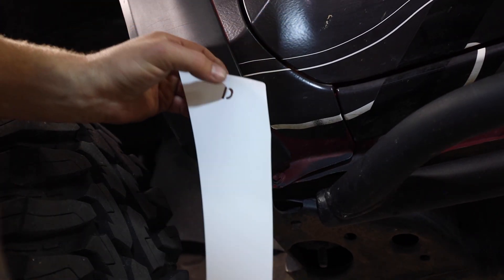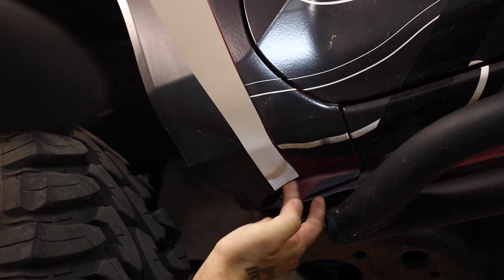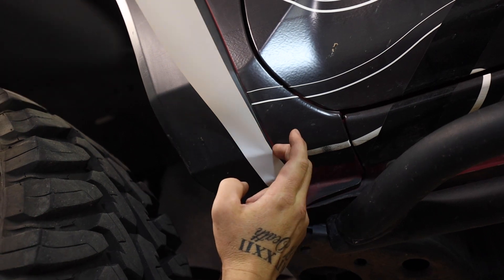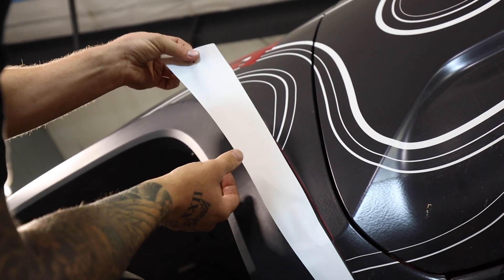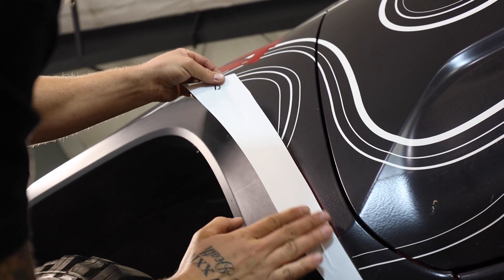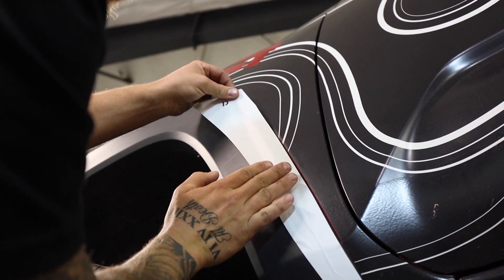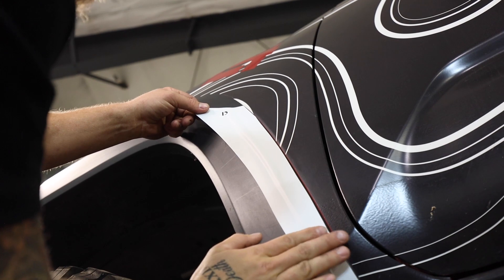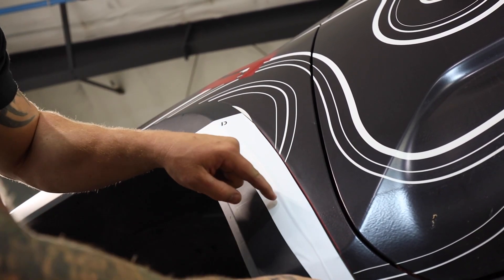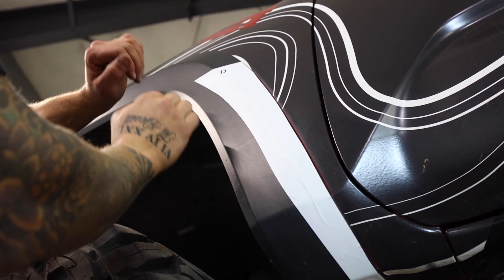Start with the letter D at the top of the vinyl going up towards the top of your fender. The small skinny end lines up right to the very back edge of the flare, and that's where you start to apply. Line up the back edge along the fender and follow your way around up the flare, keeping this template lined up with the edge of the plastic flare all the way. The fender flare does have some texture to it, so this vinyl doesn't stick permanently — you can peel it back and realign it. Don't worry if it sticks in a spot that's not exactly right the first time. The most important thing is having it aligned with the outside edge; a couple of wrinkles isn't a big deal because after cutting you'll be fine-tuning and cleaning that up with your cutting device anyway.